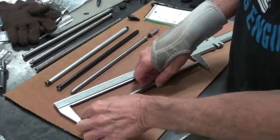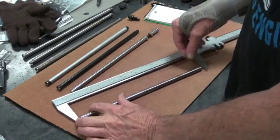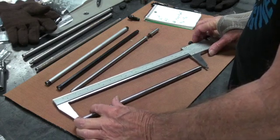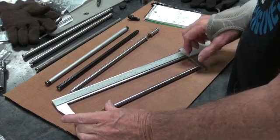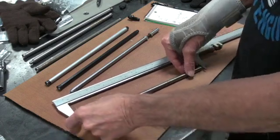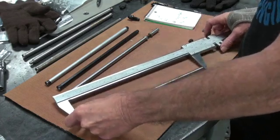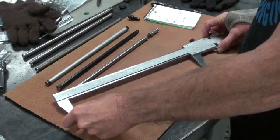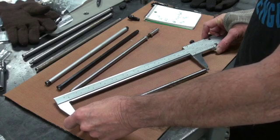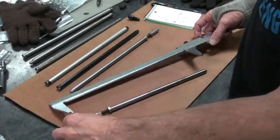So we'll put that in there and come up with a number to give them for pushrod length. I normally do this in my lap. It's a little easier than struggling here. Okay, so that minus 250 for the ball is our net length.